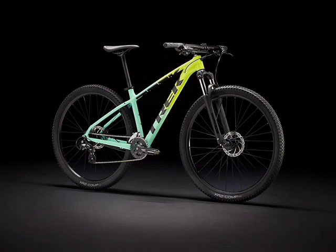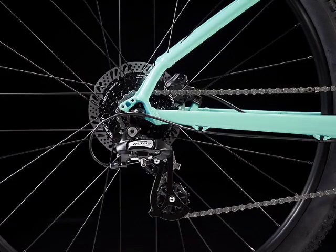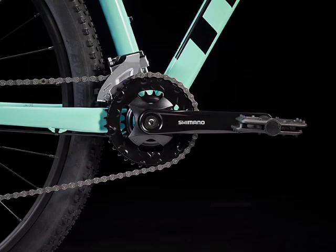Next is the Trek Marlin 5, which has higher specification than the Trek Marlin 4. The Trek Marlin 6 has higher specification than the 5, and so on. On the rear, we have the Shimano Altus M310 with 8 speeds. This is a step-up from the Trek Marlin 4's 7 speeds, meaning you're going to get more climbing efficiency and better ratios from the smallest gear to the largest. For the front derailleur, we also have Shimano Altus, the M315, with 2 speeds. The smaller cogs here are going to help with climbing efficiency and improving the ratios on the rear.